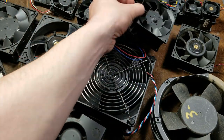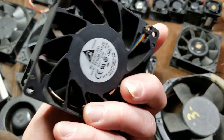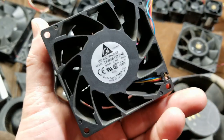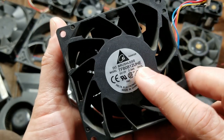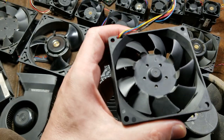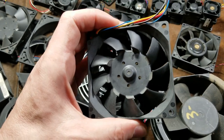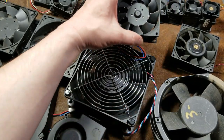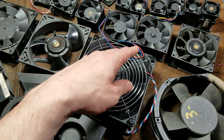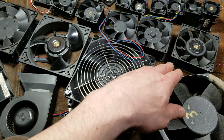The standard size computer fan is known as an 80 millimeter. This is what just a standard grade version would be. On the extreme high end, this Delta — part number TFB0812UHE — actually stands for ultra high end. When this fan came out, it was the highest-flow 80 millimeter fan available on the market at 106 cubic feet of air a minute. Really a pretty amazing fan.